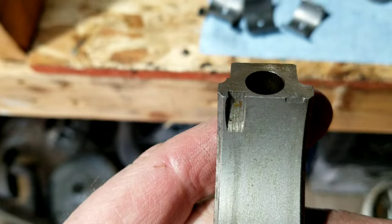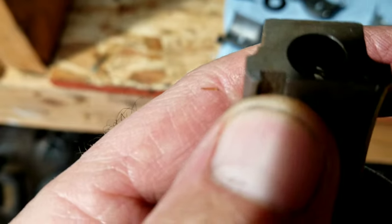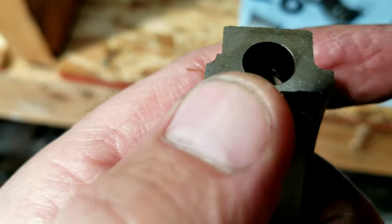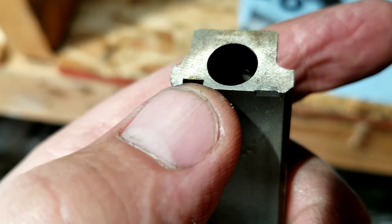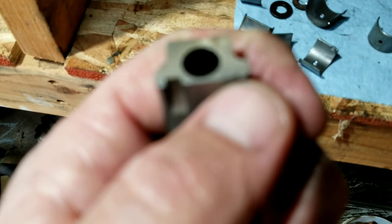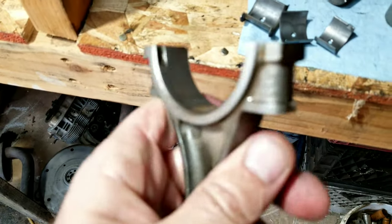Found it. One of our rods we had, I don't know what happened here, but if you look right there on the tang, you see that little edge that's kind of bent over. When it was all together, we checked it and checked, and that little thing there is pushing the bearing ever so slightly. It made that one go on tight. It looks like there's more going on over here, but it's actually not. When it's all together, the rod specs out.